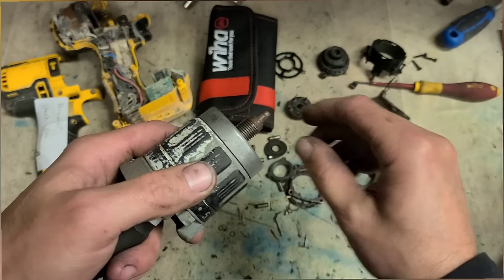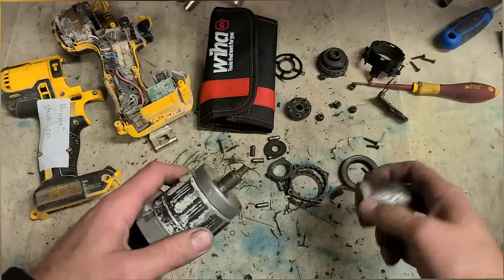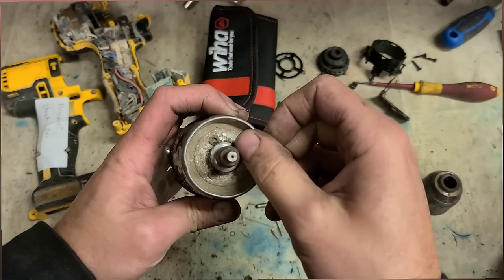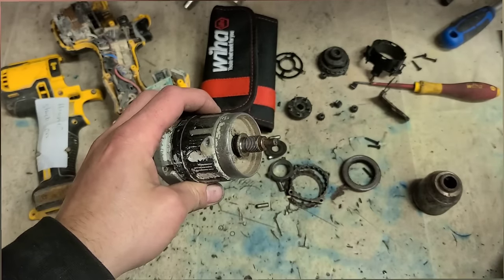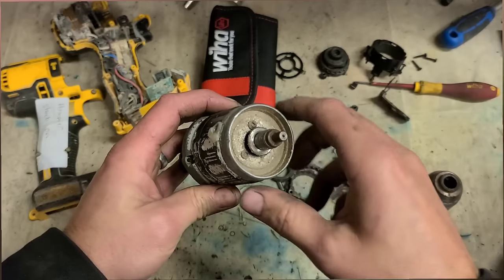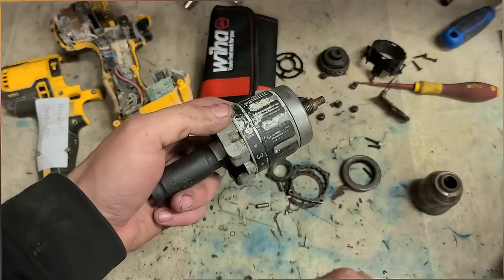Chopping it down around here, which will be roughly about there. Slice through it, that breaks off the chuck, and the remainder of the chuck then you just cut down through one side of the thread, just to the end of the thread. That breaks the clamp, you can just knock it off then. So it'll just leave you with this end here. You can dismantle this clutch assembly to get in to see what the problem is. If it's just a bit of melted plastic, you can remove it, but otherwise, same dismantling job to replace the actual clutch housing.